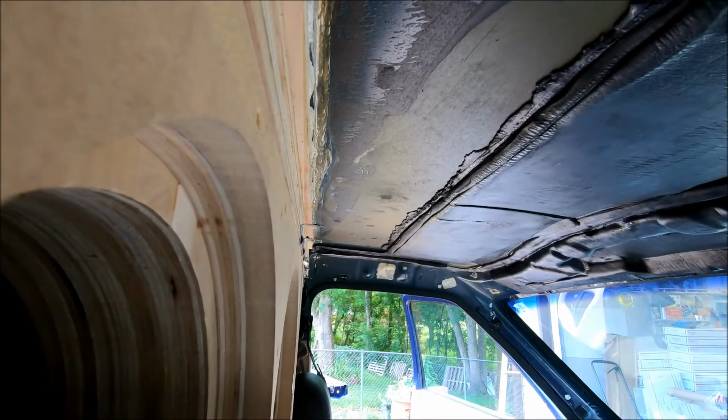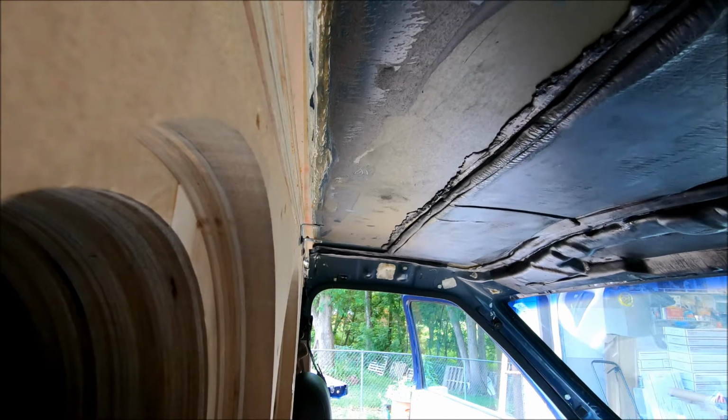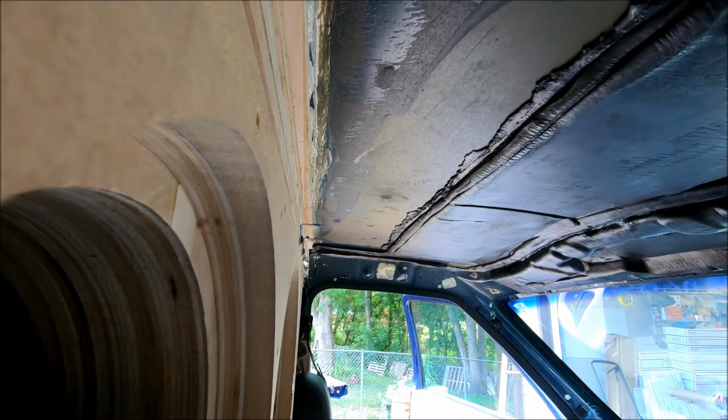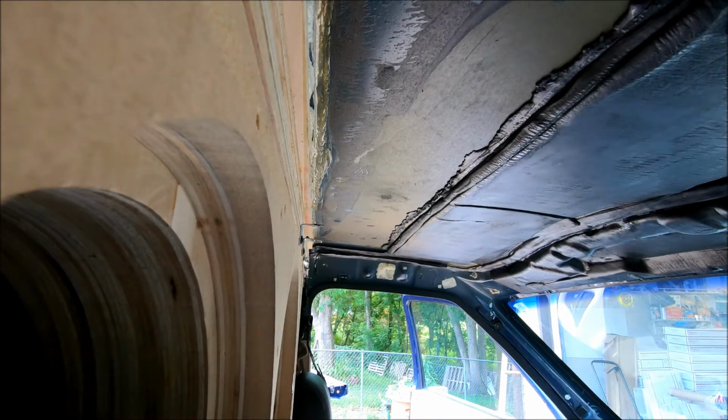It's a pretty warm day out today, getting some cloud cover and some actual sun, but just to show you what the Vibraflex reacts like once it's warm, I'm pushing on the top of the roof right now, and you can see it move downward. So when it's warm, it just reacts like a mass loader. When it's cold, it's rock hard.